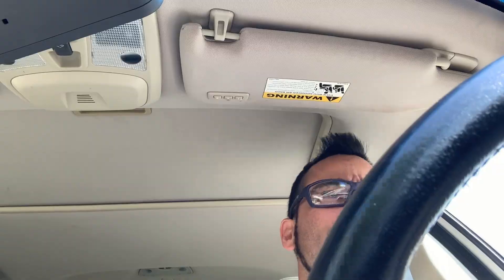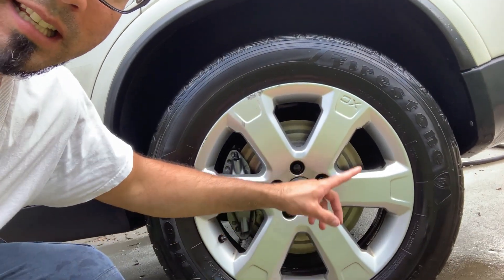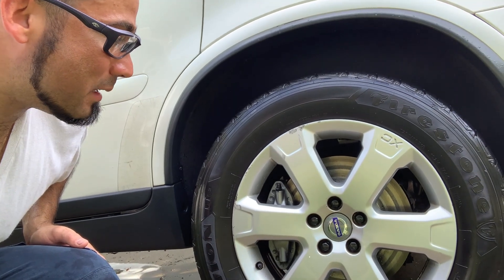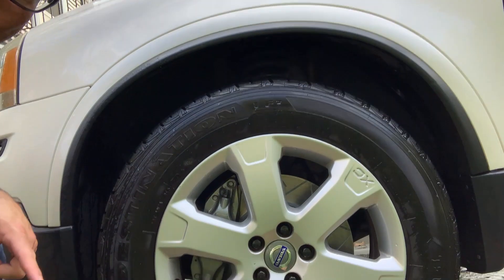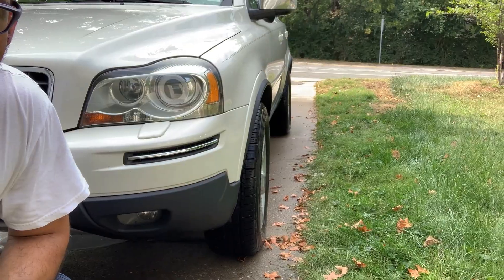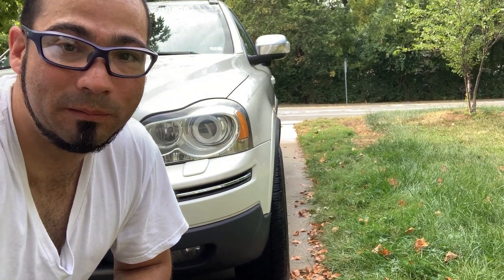The other thing I don't necessarily like is my wheel spacers — the outside diameter is smaller than the contact area between the rotor and the wheel. I think I am getting a little better brake feeling as I go — I'm on the highway doing 65 right now. I stopped to inspect — this is the wear pattern. You can see the dark marks and light marks; that just means the pad's not fully engaged yet. As the brake pads bed in, I think my brake feel will get better. Here are the front brakes with that cool groove pattern, and the wheel spacers give it a cooler stance — the wheels are more in line with the outside of the vehicle.